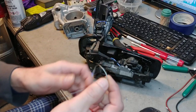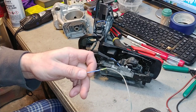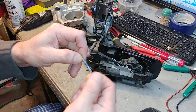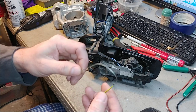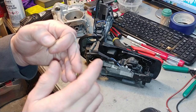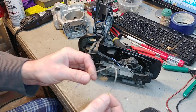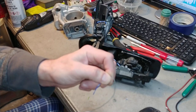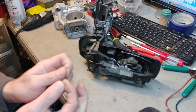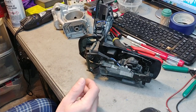There were wires all touching — that's not good. This other wire also had insulation flaking off and corrosion starting, but further down they're fine because they're not subjected to such heat and motion. Every time the mirror folds in and out, the wire bends repeatedly — it tightens up when it folds in and relaxes as it opens. That's what causes the damage right at the fold point.